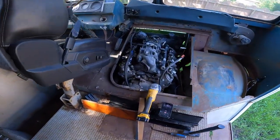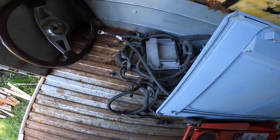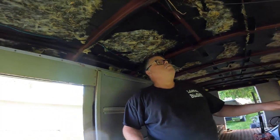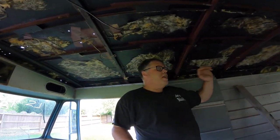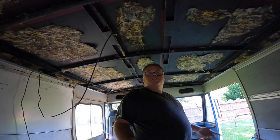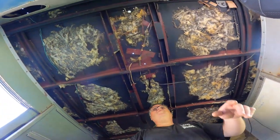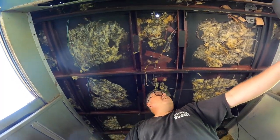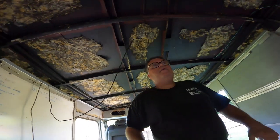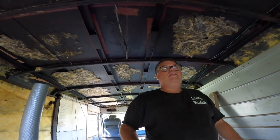Next we've got to do is this LS — we've got to get it running. We've got the wiring harness right here, the gas tank's right there, we've got the harness here with the computer. So we just got to figure out the harness. We've got to get the engine running before we put too much time and effort into this thing. If it's running, I can move it to the front garage when I want to work on it. It needs a drive shaft too, but I've got three in the garage, so hopefully we may get lucky. I'm pretty happy with the progress just today even — we got the roof up, and we just got to seal it up. Weld up all the little holes in the roof — there used to be sirens and everything else in this thing. So we've got to get the welder up on the roof, weld that up, and maybe even weld that back seam from the roof side. We'll see how it looks up there — that'd probably be better. Then seam seal it, that way it's solid. We'll get all this cleaned up and go from there, Jim.